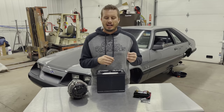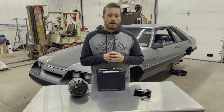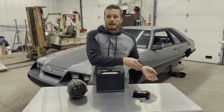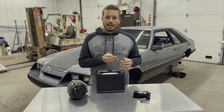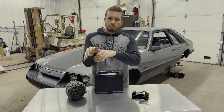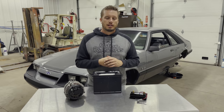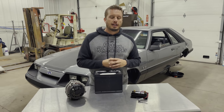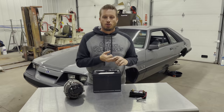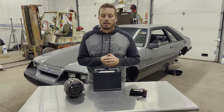That's a whole other video — I'll post the link in the description below so we don't get too far into the weeds. What you need to know is that your alternator is only charging your battery; it is not feeding back into the rest of the system. Once you understand that — alternator right to battery, everything else from the kill switch to power the car minus the EFI system — you now have a correctly interrupted system. When you kill it, it kills the whole system: fuel pumps, water pumps, thermal oil pumps, ignition spark, everything. It's truly separated at that point.